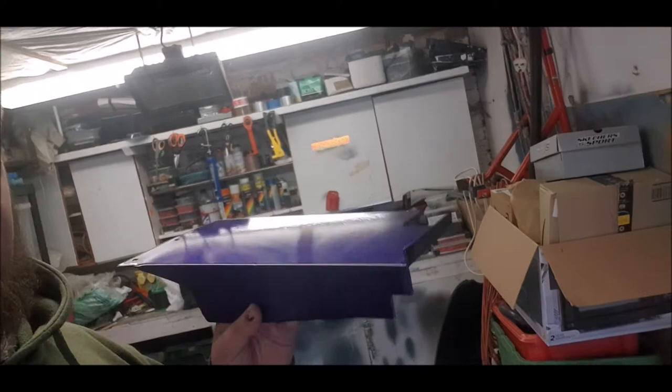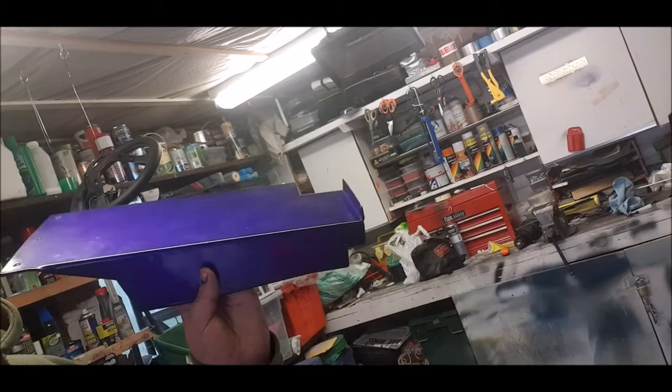Back down at the garage again for another video. In this one I'm going to be showing you how to install an E36 kick plate into my BMW compact. The kick plates are used to replace the carpet on the BMWs because the carpet sits a certain distance from the accelerator pedal. When you take out the carpet, you have a gap between the floor of the car and the accelerator pedal. So I bought this little plate that came already bent — it's all pre-done. I've had it powder coated. Basically this plate just fills that gap so you've got something for the heel of your foot to sit on.